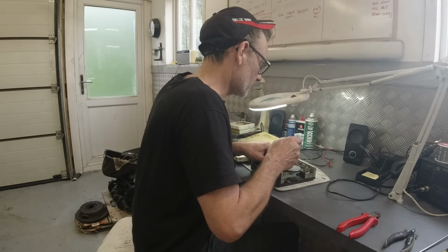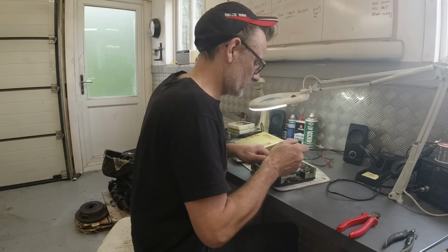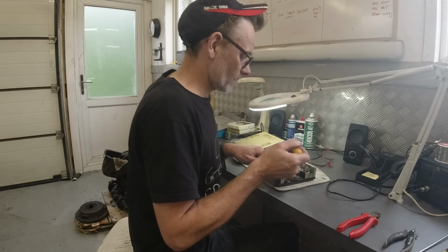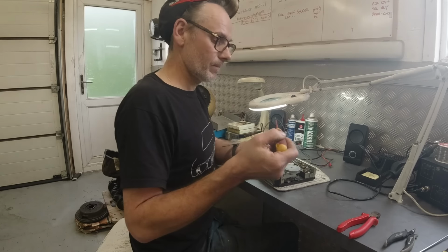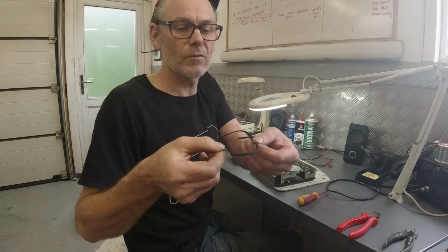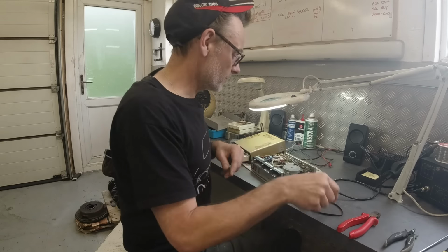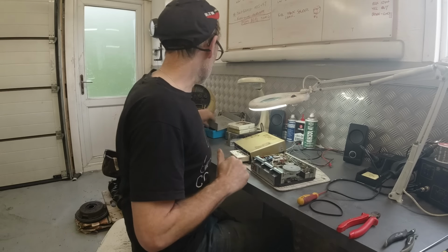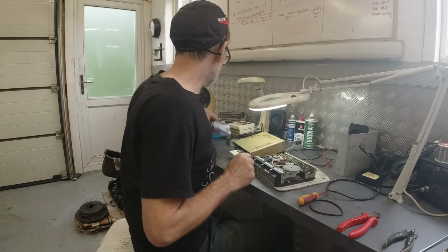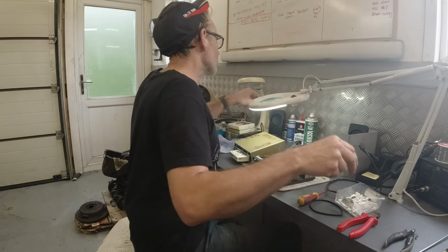Yeah, the belt, I've got some new belts on order. This might work for a bit, stuck to it. Just there. Let's have a look at that belt. Looks okay, actually. There's a little sticky patch on it, but belt off, flywheel's mucky. So what I'll do first, there's no point in trying to do this until you just do some basics. So it's Q-tips and contact cleaner.